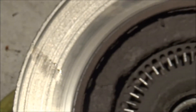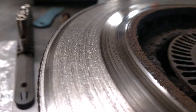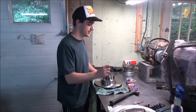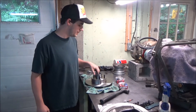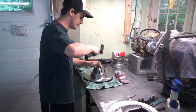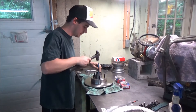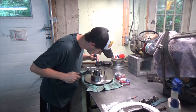That's pretty much destroyed — this is why you should change your brakes regularly. We'll get it up on the bench for a better view and throw a picture in so you guys can really appreciate how bad it is. We're in the midst of mini bike builds here, so we've got a lot going on. These brakes really couldn't wait any longer. The new rotors came with the outer races of both bearings pressed in, but I'm not comfortable using half a bearing from one source and half from another, so I'm going to tap these out and press in the new bearings.